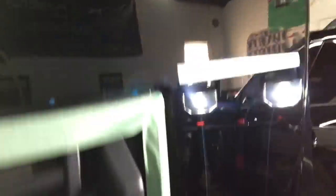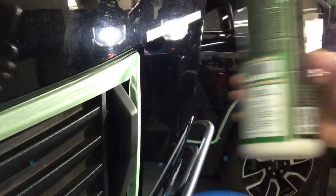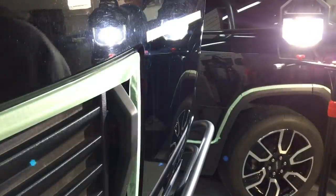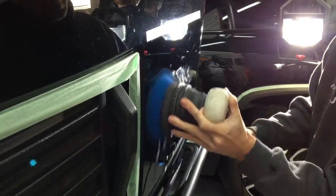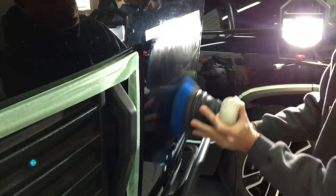As we'll be able to see, I removed everything I wanted to go after. I am completely happy with this combination — I'm going to stick with it. You can see the hazing there, so all we have to do is finish down a little bit. For that, I choose a Max Shine foam polish pad and 3D1. On some softer clear coats, 3D1 would be enough to cut and remove imperfections that are this bad, but on hard, stubborn clear coat, 3D1 is actually perfect to finish down and use for the finishing process.